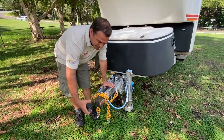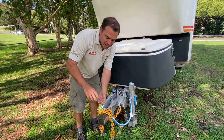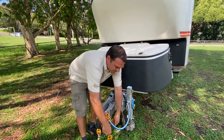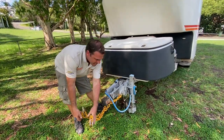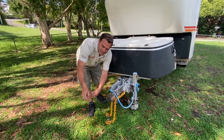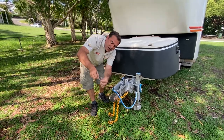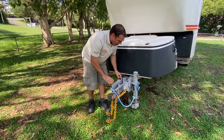We're going to give you the Treg coupling. That C will go on your vehicle — you take the ball off your vehicle and put the C coupling for the Treg on there. Pin goes through. We always cross our chains, so make sure you cross your chains when you hook up to the vehicle. Anything over two ton has a breakaway. Attach this to one of your D-shackles. If you need to make it shorter, you can loop it on itself and use that as a breakaway for the electric brakes.